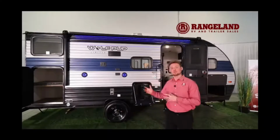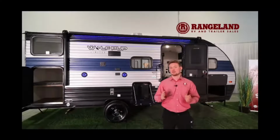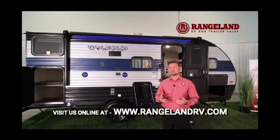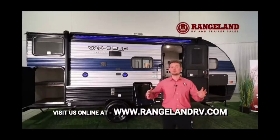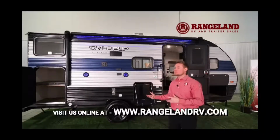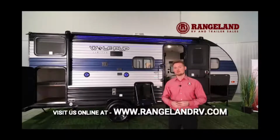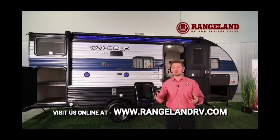Now this is an aluminum sided trailer with a wood frame, and what we do is a 12-inch on center stud in that wall, and we do a 5/8 tongue and groove plywood. The reason why we say this is important is because a lot of our competitors in the industry use a 16-inch spacing or even a 24 when it comes to their wall construction. So with a 12-inch on center construction, you have a lot more stable frame, because you think of it this way, this trailer goes through an earthquake every single weekend you take it out. So more structure, the better.